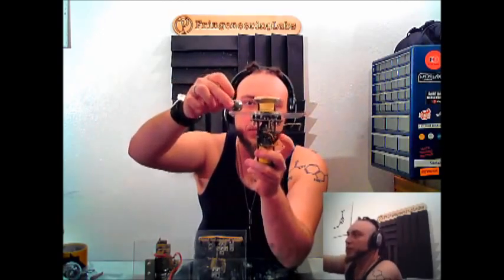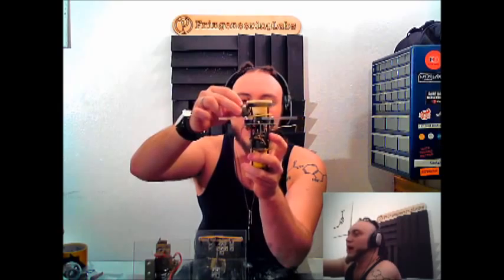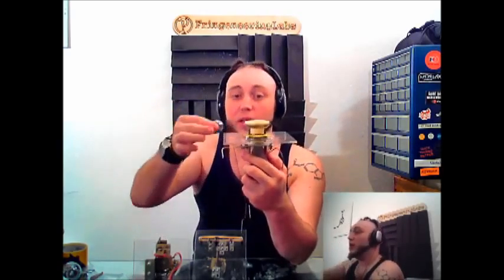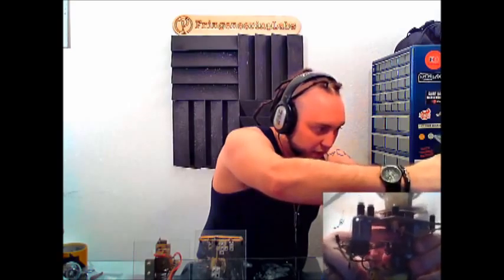If we have a pinball here, it would be moving across the table, come into contact with the pop bumper, and trigger it to come down and pinch the ball against the playfield, causing it to bounce away. The way the table knows there's a pinball in contact with the pop bumper is that it moves down this little skirt right here. You can see how if a ball moves up next to it, it deflects this piece of plastic on the bottom. That piece of plastic is connected through the table and floats above the solenoid.